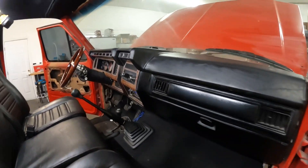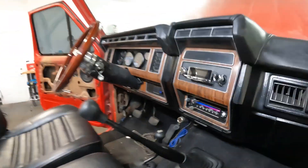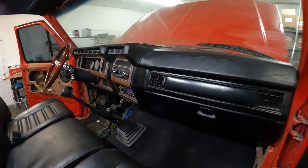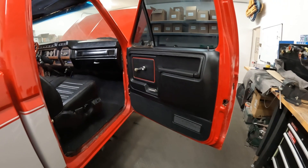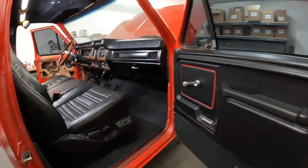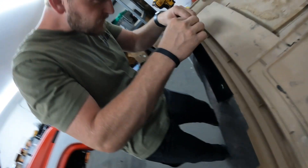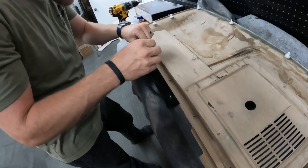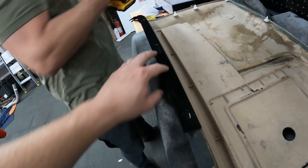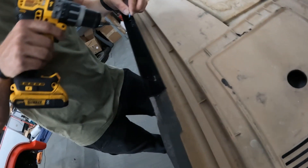Gauges work great, dimmer is in. Everything's done — radio, door panels on this side, got the other side to do. Did a little red around the door handle crank to tie it in. Brand new carpet on the bottom as well. Time to put weatherstripping around the cab and then the interior is pretty much done. This lip has to rest on the inside of the door, so rather than a bolt or rivet getting in the way, we're just running T50 staples through two small holes in the weatherstrip and into the door panel — nothing gets in the way of the door and it sits on just fine.